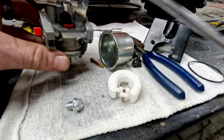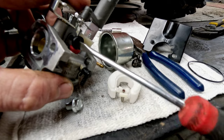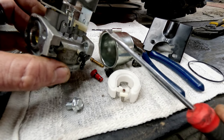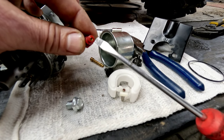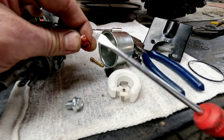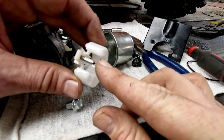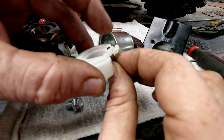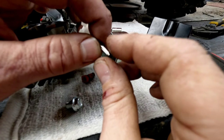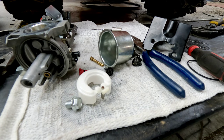From there, we'll move the governor stop — unscrew it and then push straight up on the pilot jet and it'll come all the way out. There is a tiny little jet down through here, and if you don't clean that out you will get surging real bad. The carburetor is now all the way apart. You can take the needle and the spring and everything off here if you'd like — it just pushes up and pulls straight out.